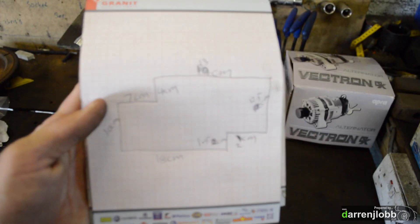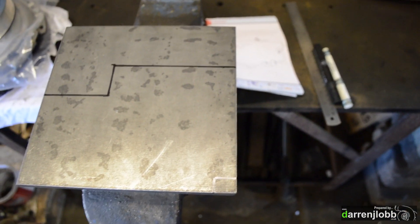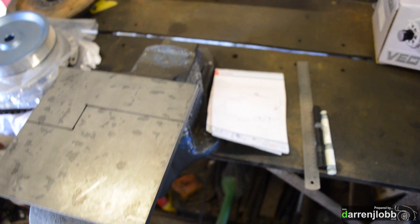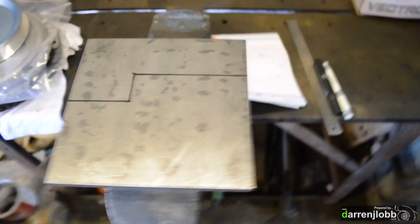What I've done here is basically had a bit of a measure up on the front of the block and come up with what's going to be a base plate for the rest of this mount to sit on. This is going to bolt to the front of the engine and pick up on some of the existing bolt holes that used to hold the original pump bracket, along with some extra bolt holes in other places just to add some extra strength. We've got some 10mm plate here which is probably a little bit overkill, but because we're going to be branching off the front of it I don't want there to be any movement at all. So we've gone a little bit thicker than we probably need just to be sure it's going to be stout in the long run.